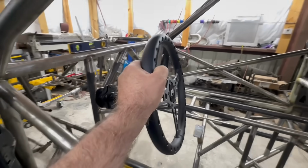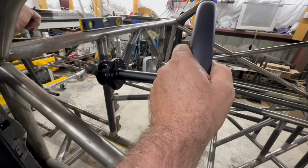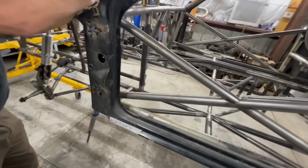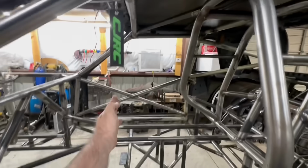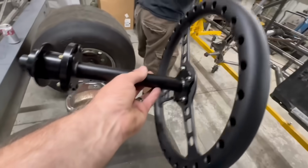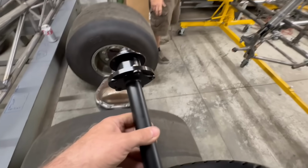On Donald's car, right now he doesn't have the removable part. I think he said something about bringing it by here. He needs to, because when the steering shaft is all the way up to right here and you're trying to get out, your space to get out is significantly smaller. So this right here is an 8-inch one. You can make them however long you want if you want custom ones, but I think the 8-inch is going to be perfect.